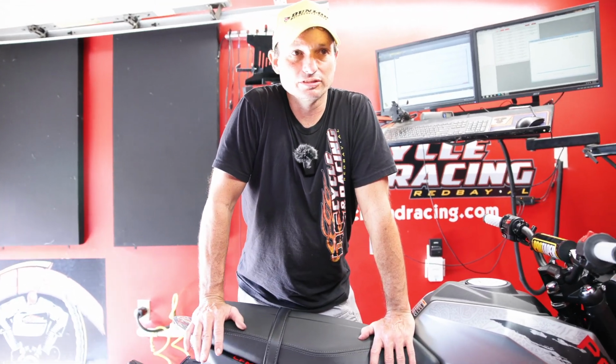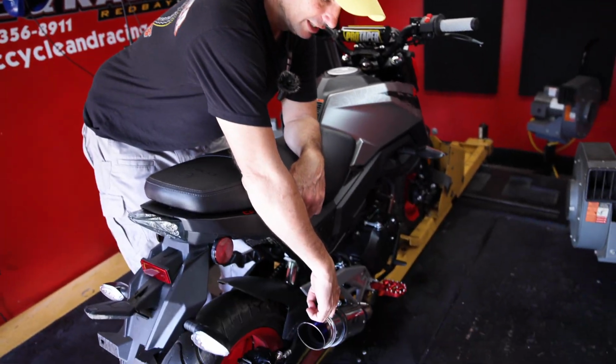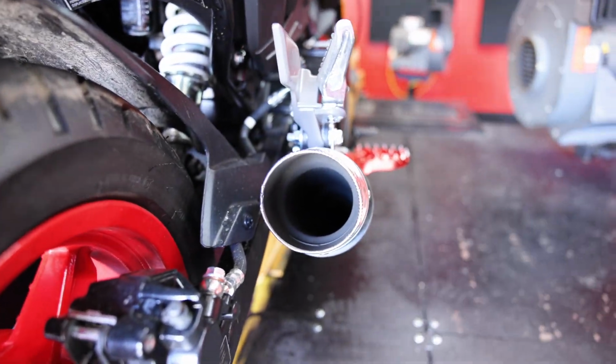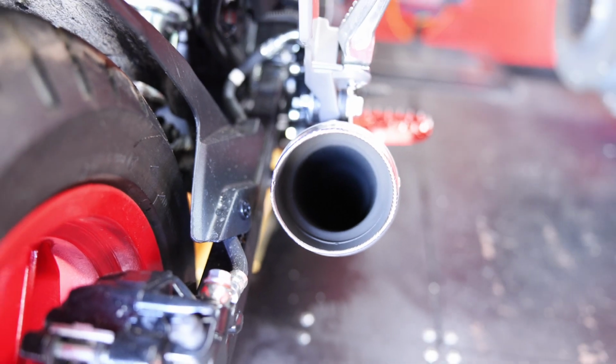Right, so there's certain exhaust you can get away with on different bikes, but if you take the back pressure off the engine, it's going to need more fuel, and it's going to need a lot more fuel, especially on low RPM. That's why it takes the torque off the bottom a whole lot. But you've got some inserts that come with these aftermarket exhausts. We noticed that if you run the insert with the exhaust, you gain the sound, but you don't pick up any power. In fact, you lose just a little bit.